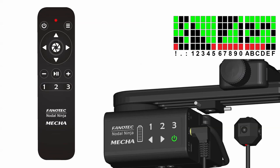The code corresponding to the 1 button is 3-3, so the LEDs should show 3-3. The code for the 2 button is 3-2. The 3 button: 3-1. Minus button: 2-9. Pause button: 2-8. When pressing the pause button, there is only one beep with a slight delay, which is normal. Plus button: 2-7. Left arrow button: 2-6. Right arrow button: 2-4.